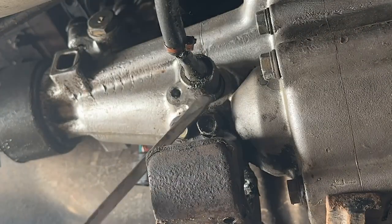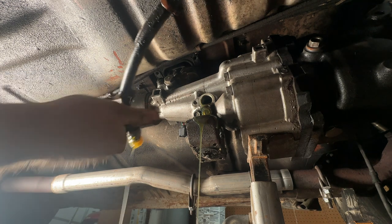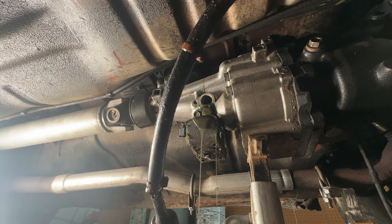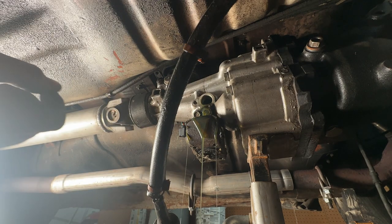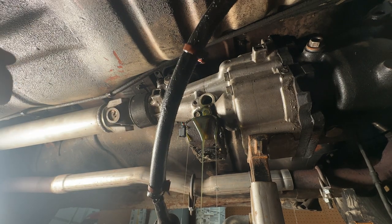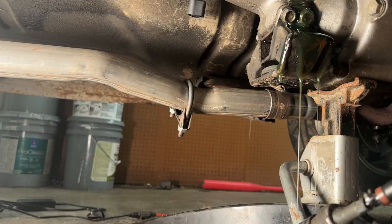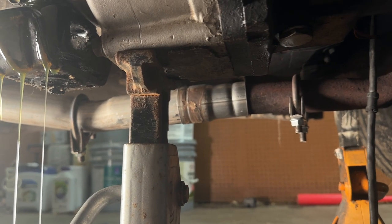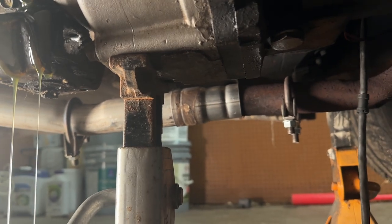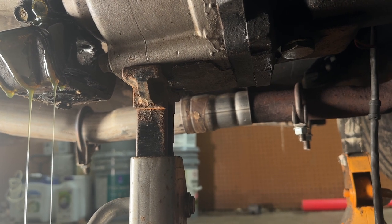I realized that this speedo gear had to come out, and then I realized that it was going to drain gear oil. And, of course, my setup is not right for receiving the gear oil, but I've got a pan under it, so it's now oozing. The exhaust is uncoupled, but not necessarily unhooked yet. It will be, though, when we give it a yank and pull the motor out. Still haven't decided. I'm probably going to take the header and the intake off, just because it's easier that way.